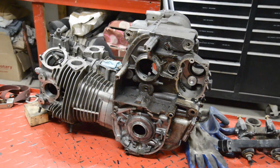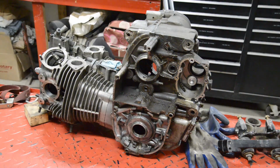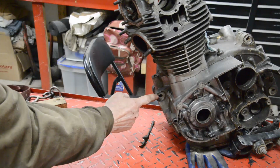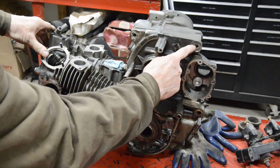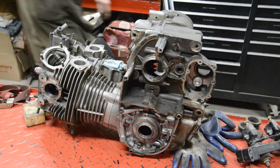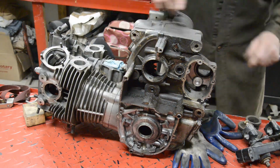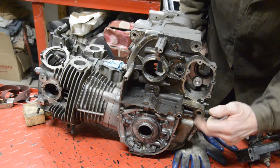Right, what are we going to do with the engine? Not a lot. There's that top engine mounting that will go in the top engine mounting of the frame. There's a single mounting underneath at the front, which we're going to plate. We're going to make engine plates for that. And as you can see, there's one there and there's one there. Right, so what we're going to do is mount, first of all, there and there, that'll hold it. Then we'll make this mount. Then we're going to do our tubes underneath the bottom to pick up this mount.